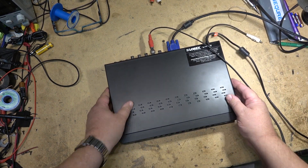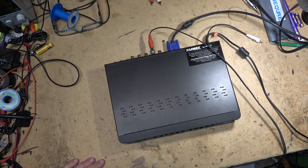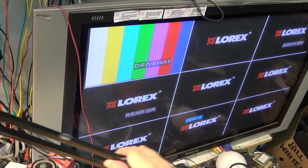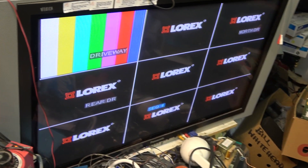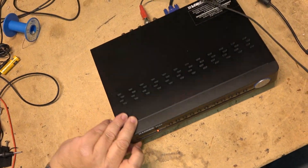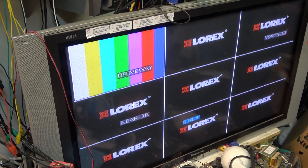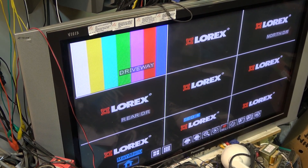The hard drive light is on constant and there's no spin-up sound from the hard drive. It will pick up my color bars from my color bar generator, but when we try to bring up any diagnostics you'll see what happens. Going into the menu — this came from a client's place, I was on a service call today. It's beeping because the hard drive has failed. Look down here, the hard drive light is lit up. If we try to look at the hard drive it'll say there's no hard drive installed.